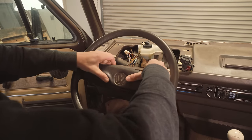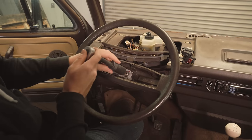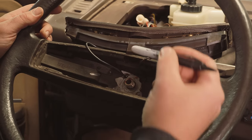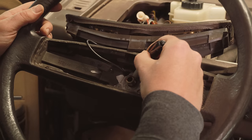For ease of removal we'll also pull the steering wheel out, which is really simple. Just pull gently on the horn button and remove the nut in the middle, which uses a 24 millimeter socket. One thing I like to do is mark where the wheel slips onto the shaft — you can do that by making a simple mark on the end of the shaft and a corresponding one on the wheel itself.